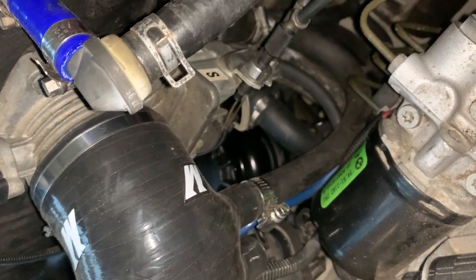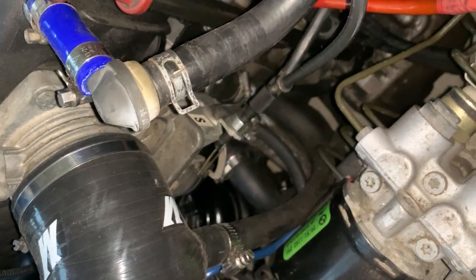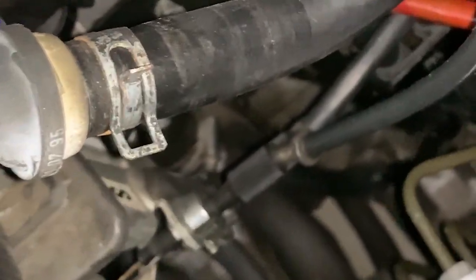You can see it goes into another one up here. Oops, yeah, that one. It's because the hose from the factory is an inch into the ICV, the idle control valve. It's an inch inner diameter, and the hose that goes into the intake boot is 5/8, 17, 18 mil. So it's really weird why they've done that and just didn't make the ICV one. I don't know, it's just a stupid cockamamie thing.